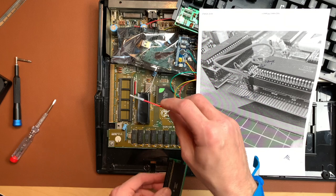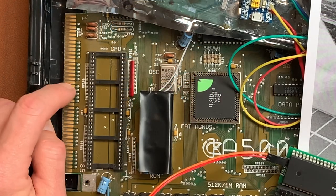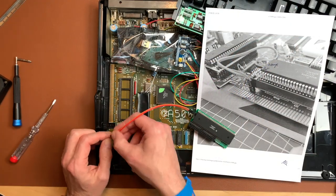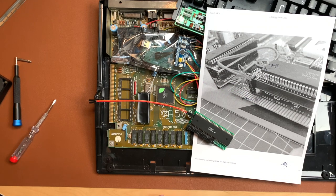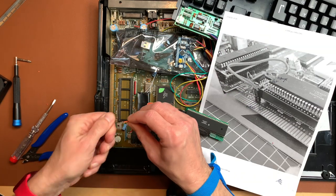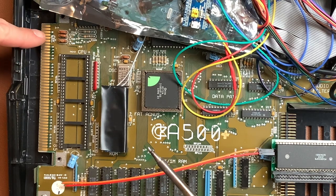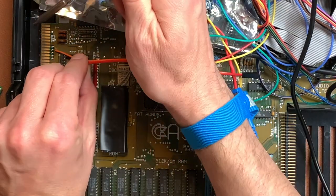Very nice. So first we go and solder these here and here, if I see this correct. These, and I don't want to remove the board from the case, so I will solder these on top and I will cut these and just use the wires. Snippity snip. Now we tin these and put them in and see what happens. No idea if this works or not. And we solder. Orange goes here and the red goes here. So just like it's here. Orange on the right and red on the left.